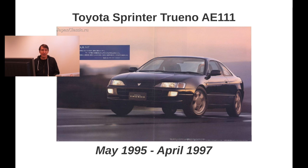Imagine that this engine was available for 15 years — and Toyota couldn't improve it much more than this while still maintaining drivability. By the end, the Sprinter Trueno no longer runs on normal petrol — you need high-octane petrol to run it. The first 4AGE could run on any ordinary petrol — 87, 91, or 95 — it didn't really matter. The final black-top engine only runs on 98 octane or higher.